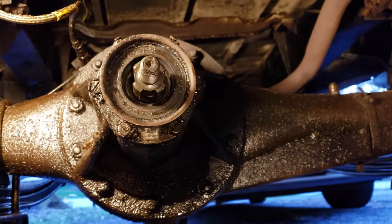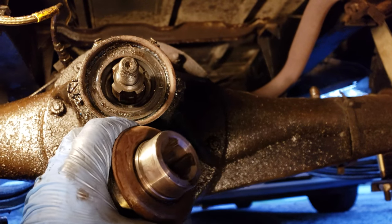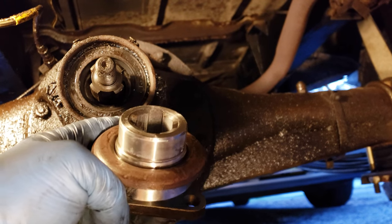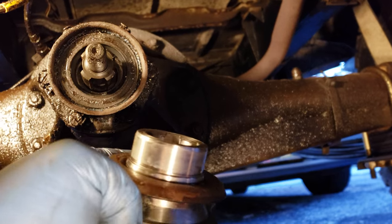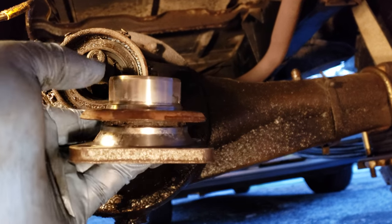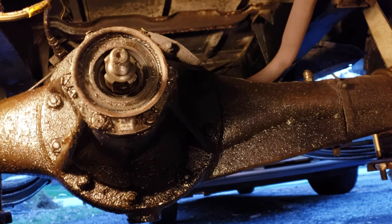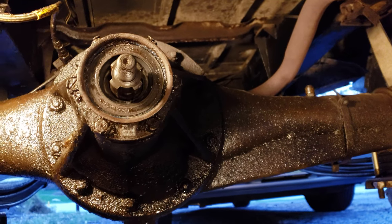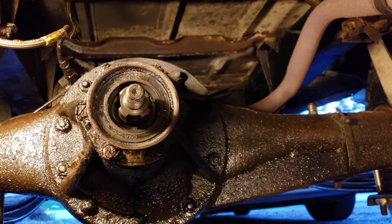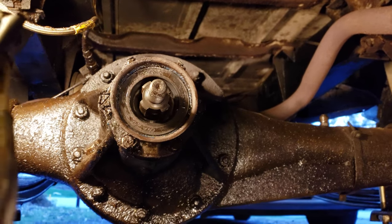I've got the seal retaining housing back on and the screws tightened with the lock tabs bent over. Next step is to install the drive flange. I used the old drive flange and a piece of pipe to pound it on with a four-pound hammer — gentle tapping and she went right on, no problem. This is the important part: this race here where the seal runs on, you have to grease it before you put it back on or use some EP90. If you start turning it dry, just like with wheel bearing seals, it'll chew itself into nothingness very quickly. I'm going to grease that, install it, and then torque it — the spec is 85 pound-feet.